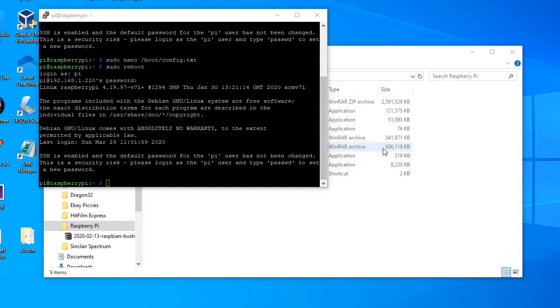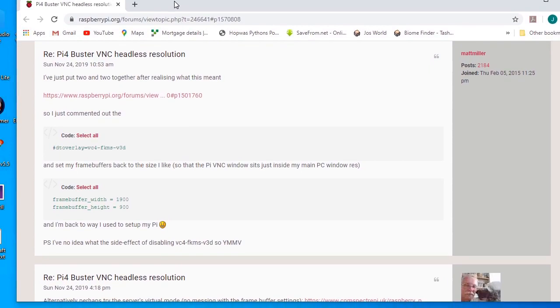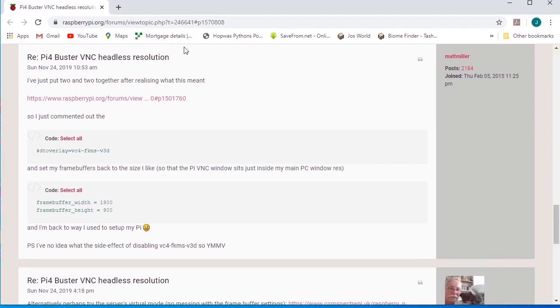Right, we're back. Now, because of this screen resolution thing, I had to pause the video and do a little bit of research, because it worked on the three, because I did it on the three and it worked perfectly. So there must be something unique to the Pi 4, and there is. And it was this. So, this person was saying that the Pi 4, you have to rem out this. There's an extra section in the config file for the Pi 4.